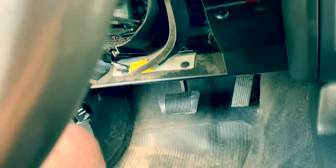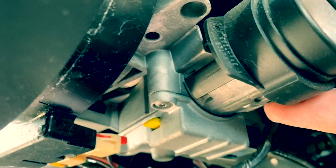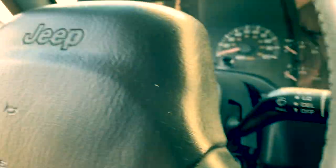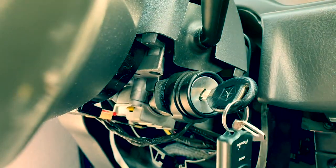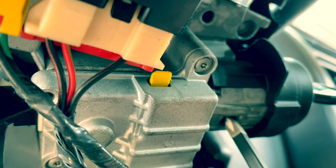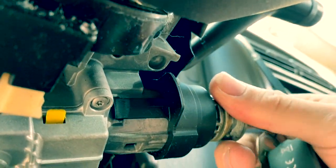Now that we made some room on the floorboards, we can actually sit in the driver's seat. What we need to do is take out the whole ignition cylinder, and to do that there is a button on the back side — actually on the bottom here. So what you need to do is take your key — keep in mind I did disconnect the battery — and turn it to the on position. This is the little button you need to depress — see, it just pops right in. Now go ahead and slide the whole cylinder out.